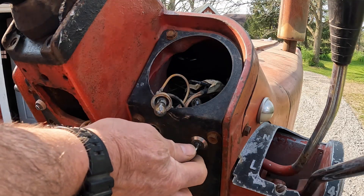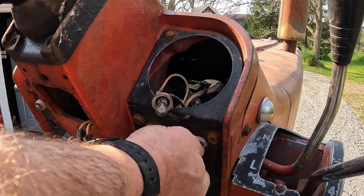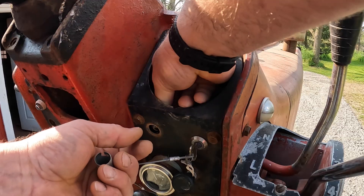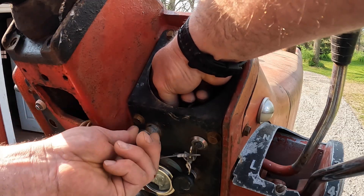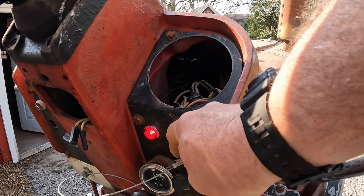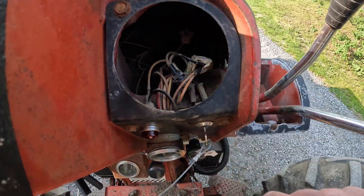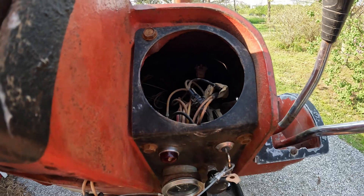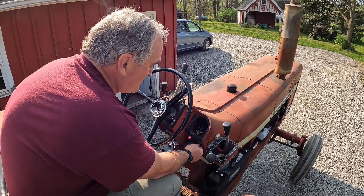Then we'll give her a little test. When I turn on the key, the bulb should come on. Yep — that spring goes on there. Shove the whole thing down inside, put the lens back on, give it a little test again. Yep, we've got light. Now if you don't have the convenience of a gauge out like I do to reach in, this cover comes off really easily — just undo these bolts here and the whole thing tips out so you can get to the lights that way.